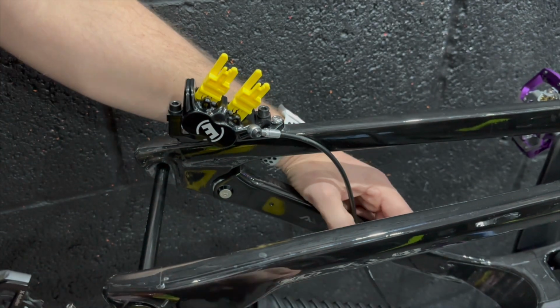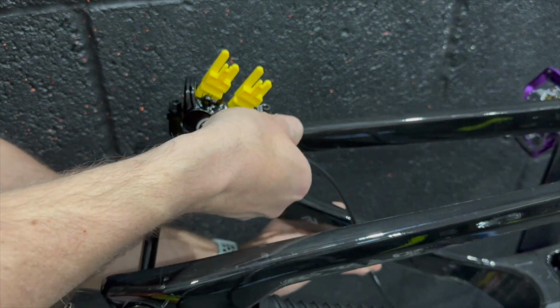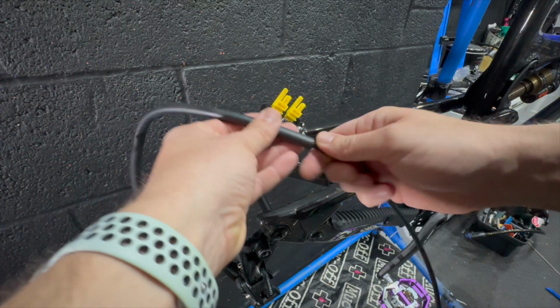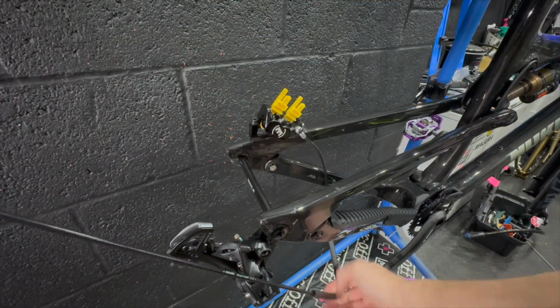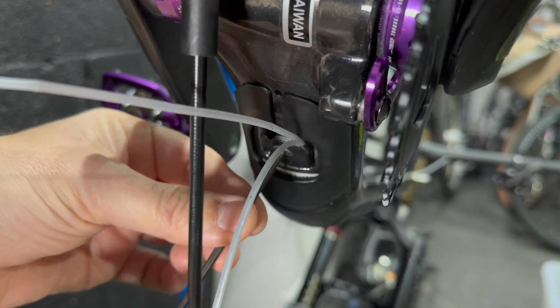It's all magnetically pulled towards the pistons, which I think is a superior system, because I've been in the Alps before and those little springs have just melted off with excess brake dragging down really steep alpine off-piste descents. I've absolutely destroyed those before. I find them a bit of a pain. So yeah, I really rate the Magura brakes. They're a cool industrial design with their carbon stuff at the top.